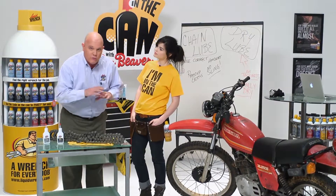Wait for it to evaporate, and if you want to be absolutely certain you've got the excess off, just wipe the chain down with a rag to remove as much of the excess as possible. If for dirty, dusty, off-road conditions you've still got concerns, use dry lube on the chain to prevent any dirt pick-up.